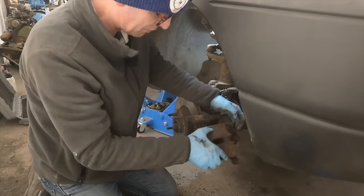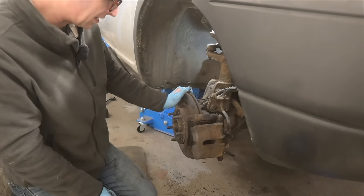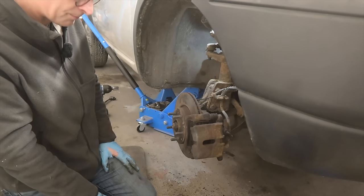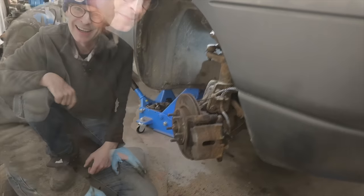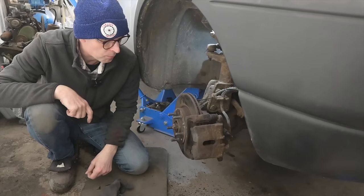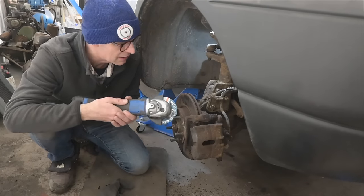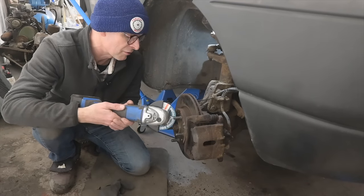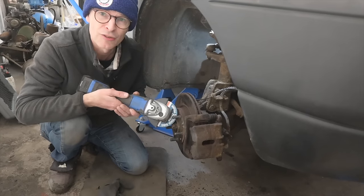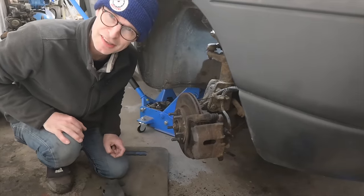I do actually have a proper hanger for this thing and a compressor as well to squeeze the piston back in again. Now I just need to get the disc off — might need extreme violence. I don't have a drill up here because the last resort generally with this kind of thing is to drill out the head of it, but I do have an angle grinder. So I think the last resort is going to be being very careful not to touch either of these wheel bolts, just get that in there and grind the top of this bolt off. Obviously I'm going to use hand protection, eye protection and ear protection doing this.